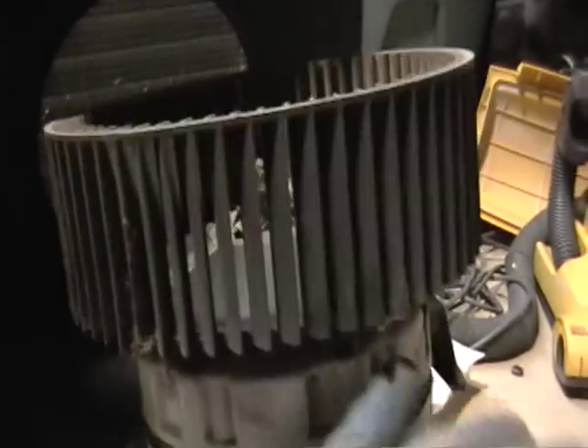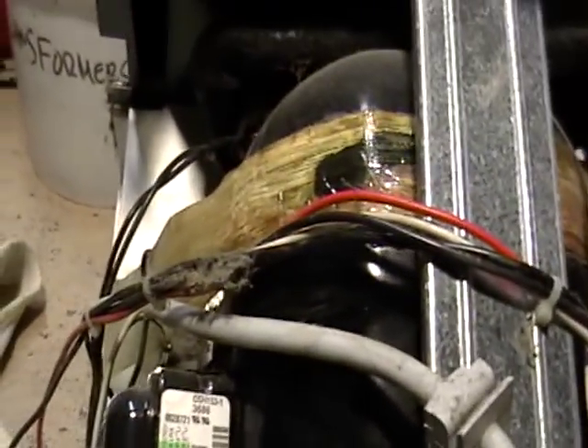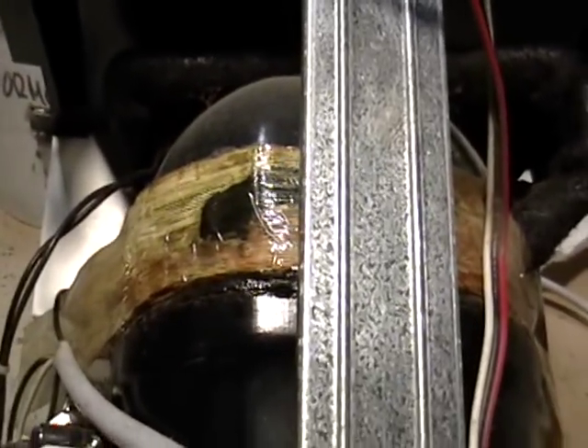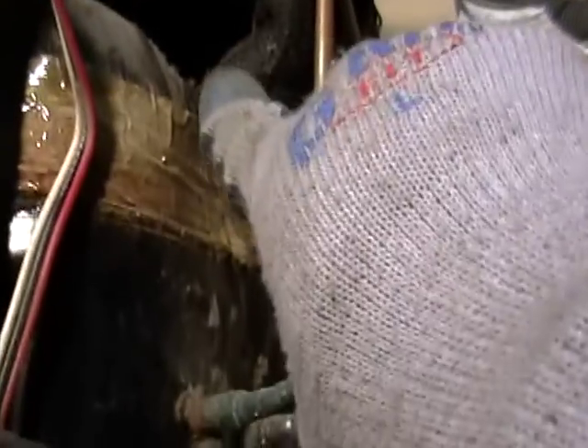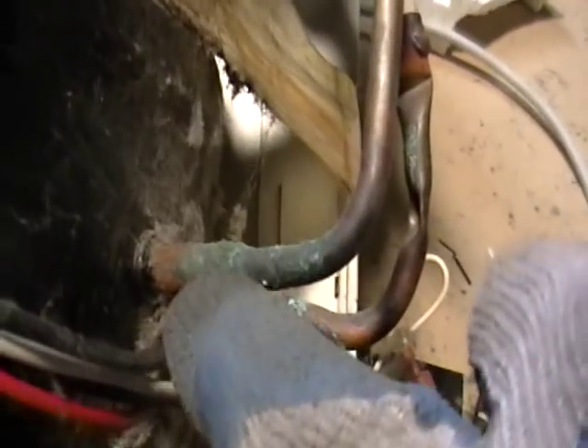Now let's go to the back here. This is the motor. The motor has copper — you can actually take it apart if you like. Take this pin right out, pull that out, the plastic comes out, or just hit it with a hammer and it should come right out. Underneath, down here, is the compressor. If you remember the last video I showed you about what's inside a compressor, you'll know it's not worth taking these sealed units apart — just scrap it as is. Now this big long black tube has copper under there. If you clean that up, you can probably get number one copper for that. But this section is number two copper — you can see it's oxidizing right there, which makes it number two. So if you cut a piece here and cut all the way to the other end where it's not oxidizing and is clean, they'll give you number one for that.